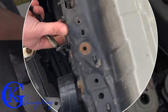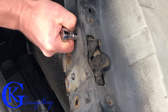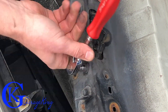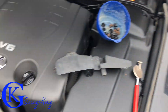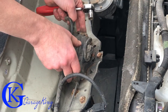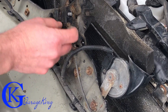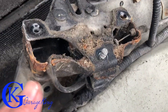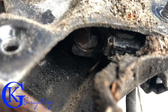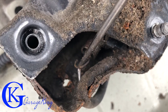Now all we've got to do is undo the two bolts holding it on — they're fairly tight. I've got a little quarter-drive here. Let's flip this back over — this should come loose — there it is. We're gonna have to take this apart. There's our rod, and everything is pretty corroded; it's probably best to get a new one. And as I'm looking inside, I can see right there — there's a spring that is either broken or disconnected. You can see it's not even attached to anything.